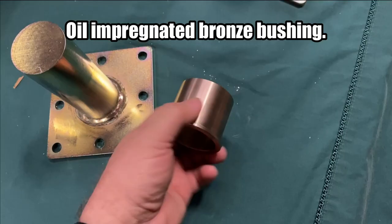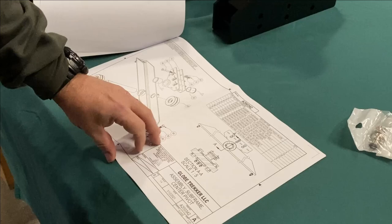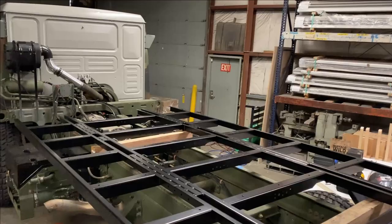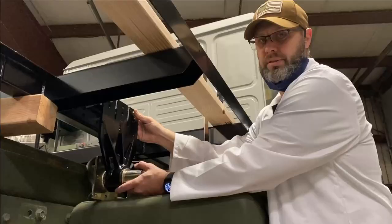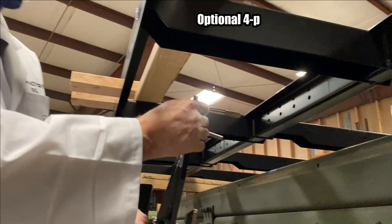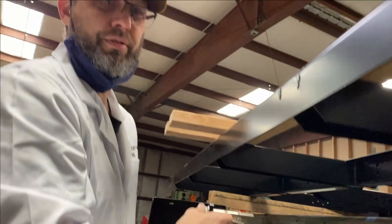This is rated at 60,000 pounds each. The engineering instructions not only give a pictorial of how the parts go together but a parts list in case you ever need to order a spare part. I recommend at least three to four people strong to be able to lift that up onto the frame of the truck — it's sitting on four-by-fours for now. With this design we're going to be 14 inches away from the cab, that's where the habitat is going to be. What we got here is a three-point front mount, and you have a full 12 inches of travel to adjust where you'd like your pivot point to be located, so it will actually clear any kind of subframe connectors or brackets you might have. If you opt for the four-point, you can actually move the bracket to the center and have almost a full 24 inches of adjustment based upon the center of the other pivots. Now let's position this underneath the back of the frame.